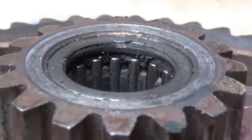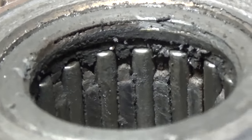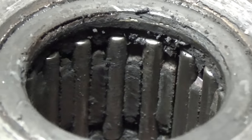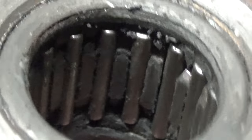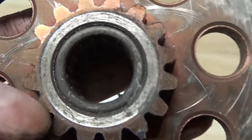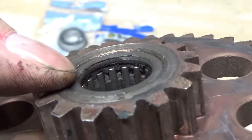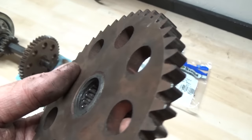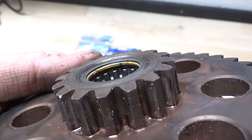Here at the workbench, I wanted to show you guys — see all those nasty bits of grease, dirt, and rust in there. Your roller bearings are those cylindrical pieces and there's all sorts of stuff built up inside. We're going to get all that out. A little bit of brake cleaner shot through there and I'll show you what it looks like once it's clean. Here's what it looks like after — you guys can see the world of difference. We've got a couple little hairs from the rag, I'll just clean that up.